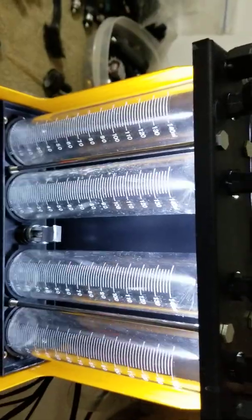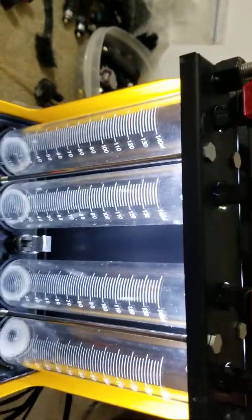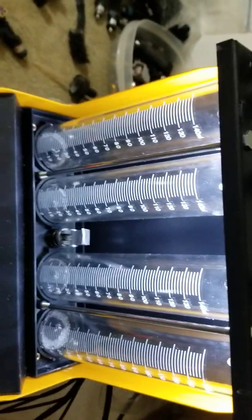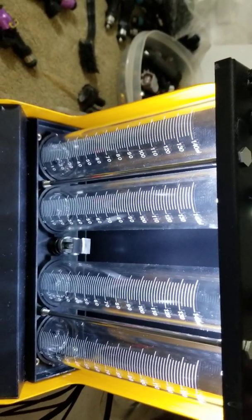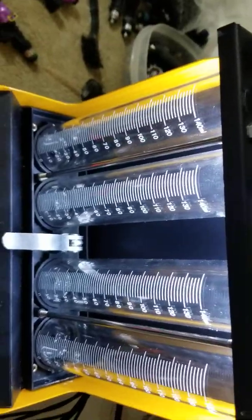Here's mid-RPM range — about 3500 RPM. The first test I'm going to do is a dynamic flow test. This test runs the injectors from idle at 700 RPM up to 7500 RPM, three times, and we'll compare the flow output.